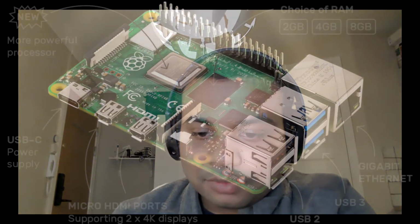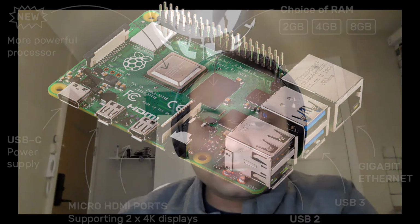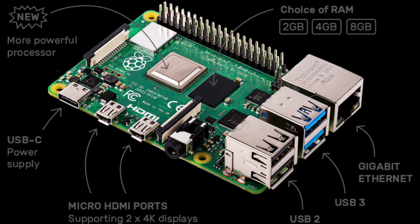One of the ports on the extreme right is the network port, called the Ethernet port. It's a 1 Gbps Ethernet port, so you can connect an Ethernet cable to this unit, for example, the cables that we were talking about, and the other end of the cable will be connected to the router. Now we have four different USB ports. Two of them are 3.0 and two of them are 2.0. The 3.0 is of course the faster one.